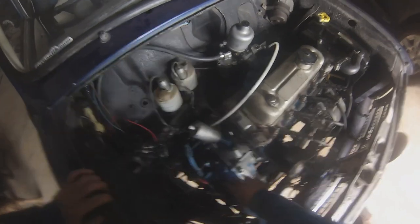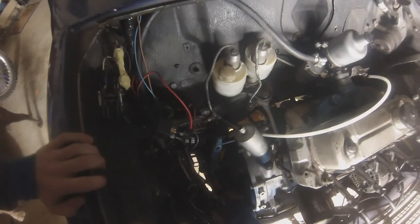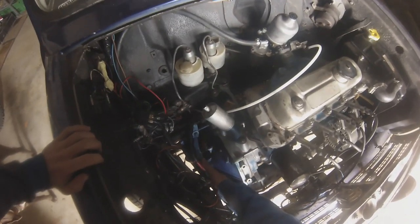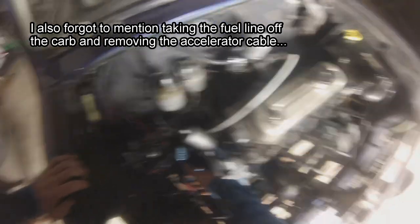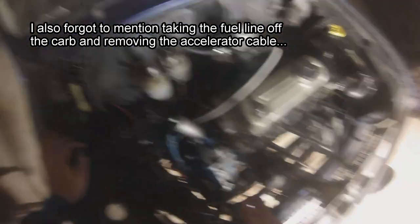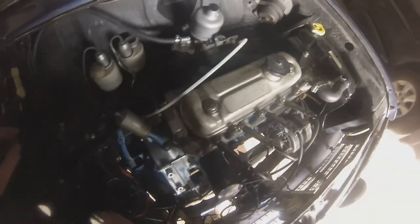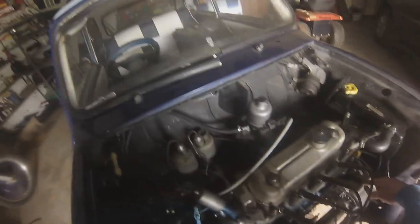And we're going to make sure that our solenoid is disconnected so we can obviously pull the engine out. So where your clutch is sitting here — I think this is called your clutch stopper or something like that — so this doesn't touch us when you're pulling it out. You're going to want to disconnect all your connections from your solenoid, and take a picture of it before, otherwise you're going to forget what you're doing. So I've done that, and you're going to want to disconnect all the ancillaries — all the things in the engine bay. So obviously your ground cable, from your coil to your distributor, and possibly even take your alternator off.